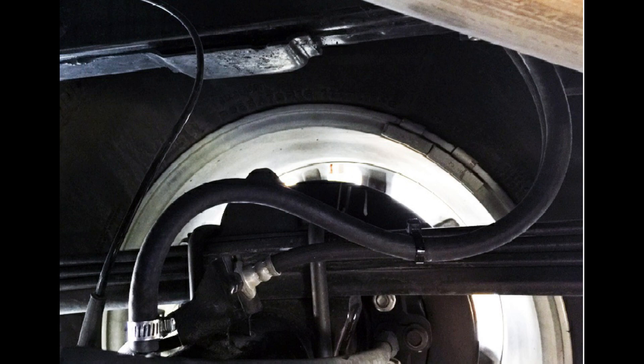I actually went on the other side of the tail lamp housing. If you lay down underneath the truck and look up inside, there's just a big hole there. The two sides of the bed metal are really not connected together except at a couple of crossover points. There's a giant hole up there. I just took the bottle, pushed it up there as far back and as high as possible, temporarily taped it in place, and then put two drill screws right through the inside of the bed directly into the bottle. It's been that way for probably a little over three years now, and it's been working fine.